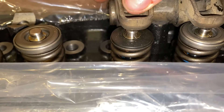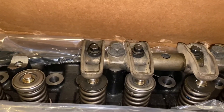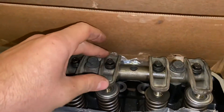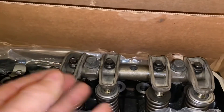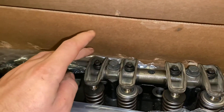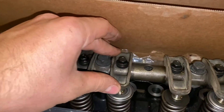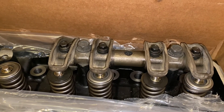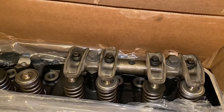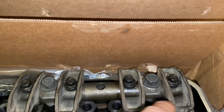Let's check and make sure we're not going to have any issues there — it looks good. The only other concern I had is that it's now metal-on-metal wear versus plastic, which won't put as much wear on the rockers. Metal on metal does cause metal shavings and flakes, but I don't think they'll really be constantly riding on these. They're just retainers to keep things from going to an extreme position. With the top end lubricated and everything covered in oil, I don't think we'll have any problems.